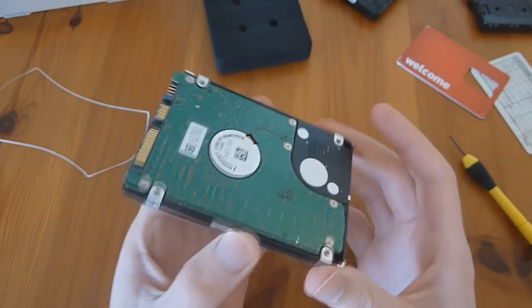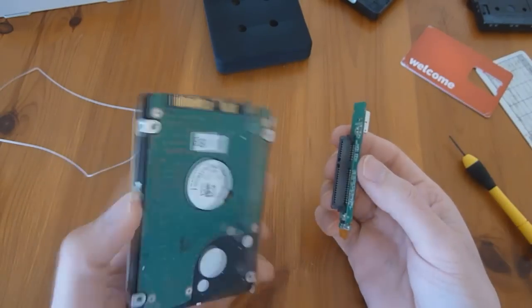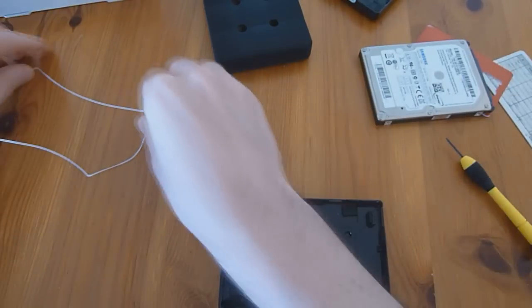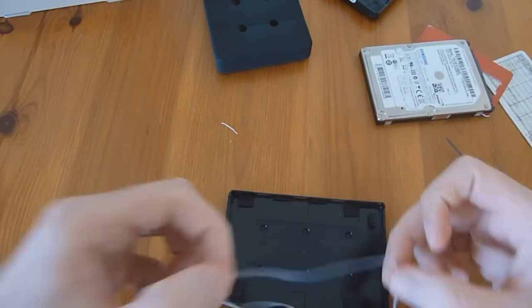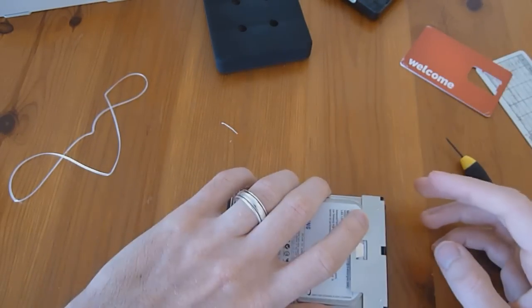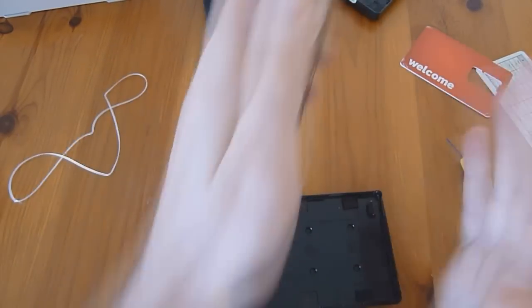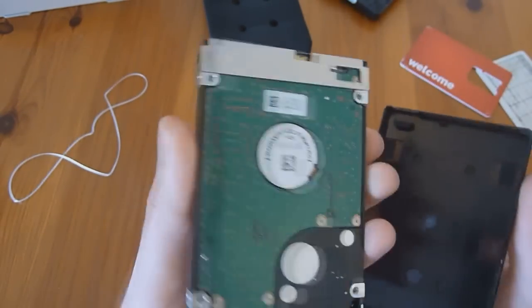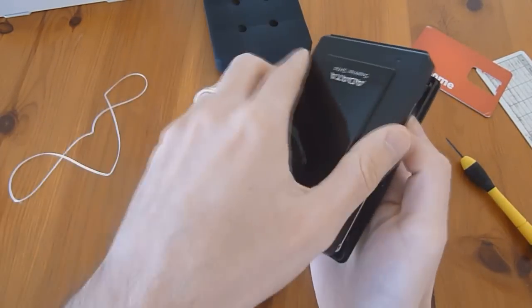Now you can use it in your PS3, your laptop, or what have you. You can either put this back in the case or use any other SATA drive by simply putting it back in and putting it all together. When reassembling, put the bottom half on first — making sure it's all even and not twisted — then put the hard drive on the bottom part first, because the connector part can be tricky to get through the hole when it's all put together. If you put it on the top first and try to sandwich the bottom on, it sometimes won't align perfectly and won't close tightly. So put the hard drive on the bottom part of the chassis first with the seal, then start from the top, put it in, push back down and around, and slide it all together.